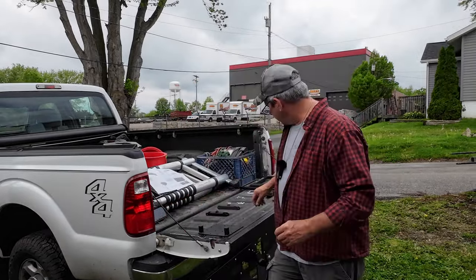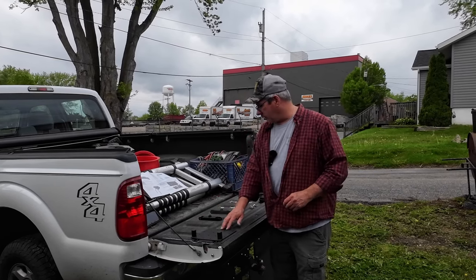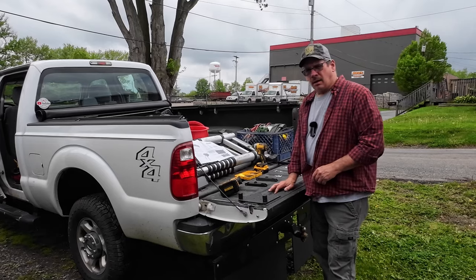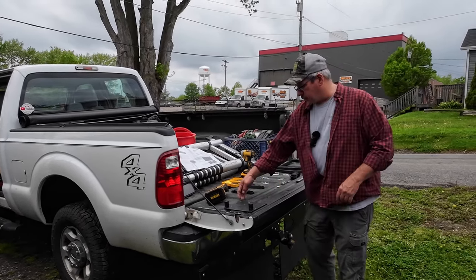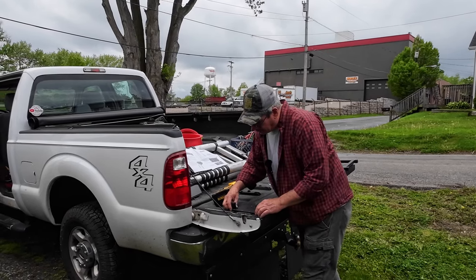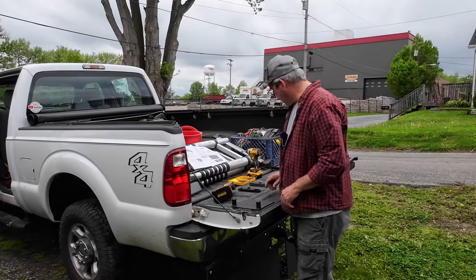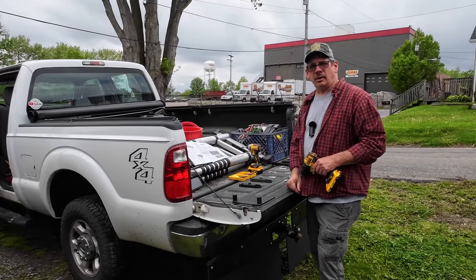But to do that, I'm gonna have to drill out whatever holes I'm gonna use here. So I'm gonna get those holes marked and then I'll drill them out and then we'll come back and get it mounted. Okay, I got the holes drilled out on the plate to a quarter inch. I actually used this seam here as a straight edge, lined it up. I am at the edge of the plate on these two sides. So I'm going to pre-drill, even though they're self-drilling screws.